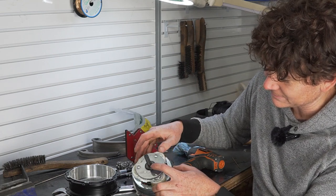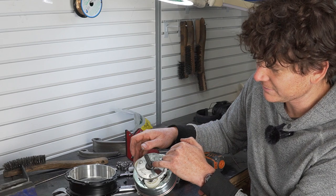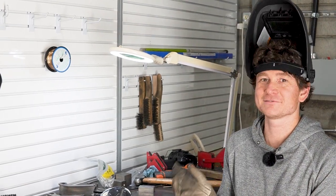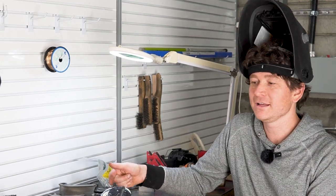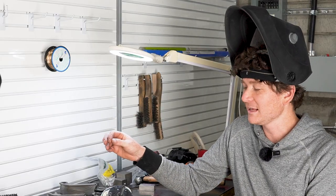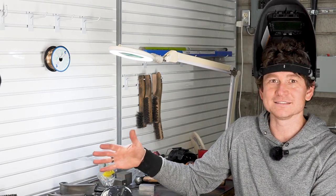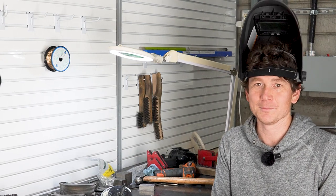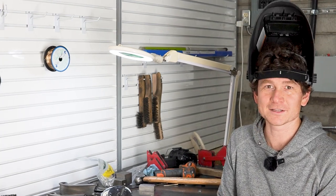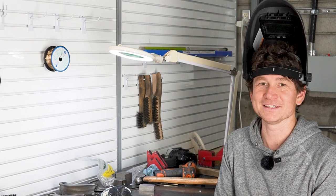The plate here rotates when the key inside is locked. Our goal is to weld this steel plate on the surface of the clutch assembly to the central core that has the keystock in it. When you have a motor open in a metal shop environment, be extremely aware of the powerful rare earth magnets that will attract every piece of iron nearby — make sure there are no small steel chips around, as those can get stuck between the stator and magnets causing scraping or damaged wires. I'm using a TIG welder, though a stick welder would presumably work too.